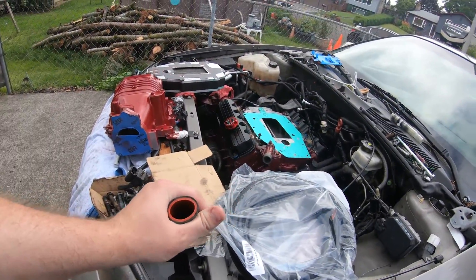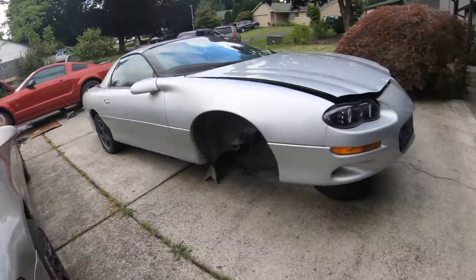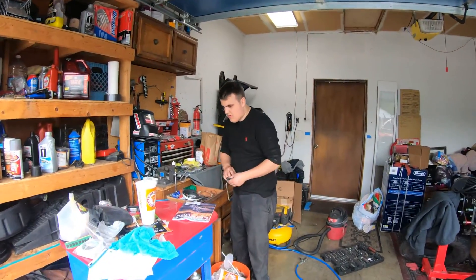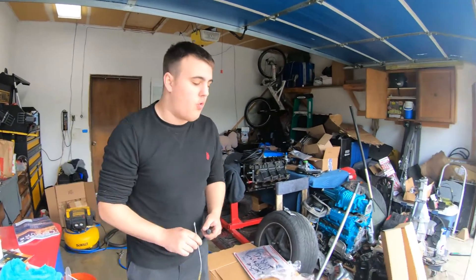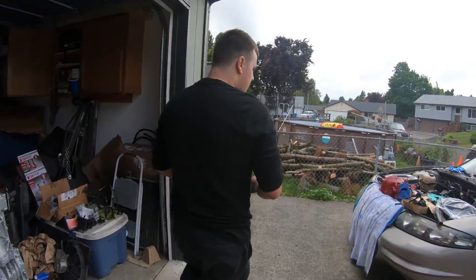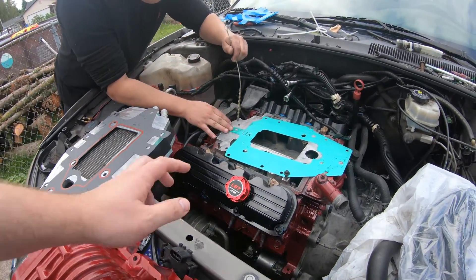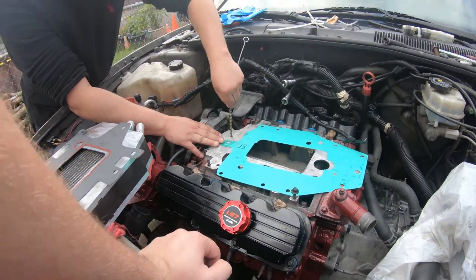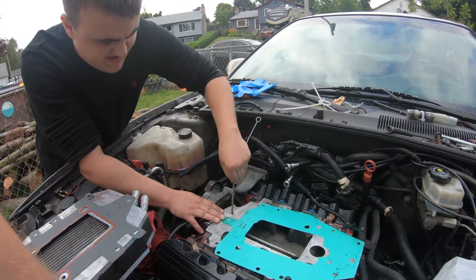This is what I bought for my Mustang, but my Mustang's not ready for the supercharger, so Tristan might be able to use it. I also have some 3/8 line. We just need an inch-and-a-quarter line for his — that's only those little things that come off the radiator. He's just going to be working on this for now, getting all the lines good. Cleaning out the threads is a good idea — it's got a bunch of RTV in it, gotta get that out.